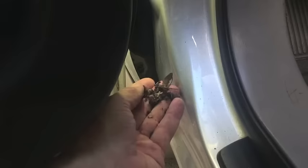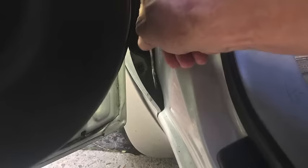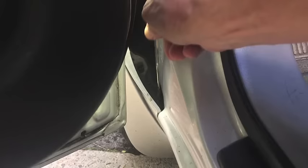You can see that it's not just leaves — there's also dirt down in there that's clogging everything up, and we even got a little bit of trash. Now, this being clogged up is not going to cause water to get into your car, into the cab. Because if it was completely clogged, any water that built up would just run out through here. It's more the danger of this being wet back here all the time and that leading to rust — that's what you're trying to avoid.